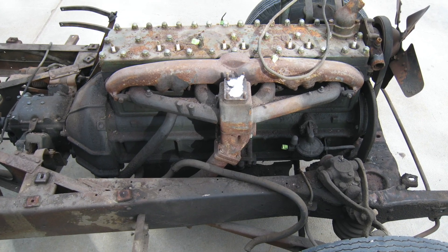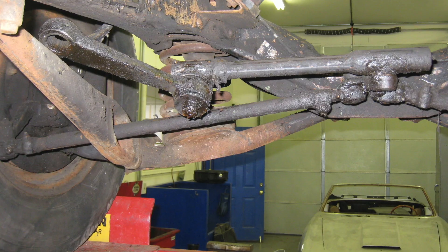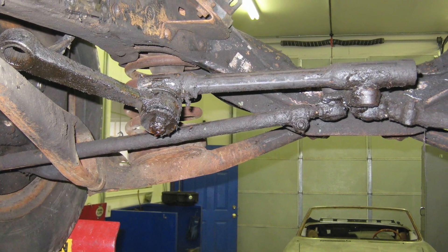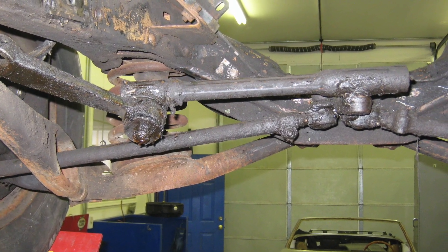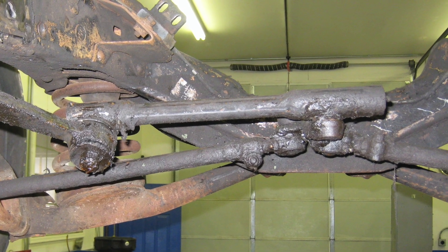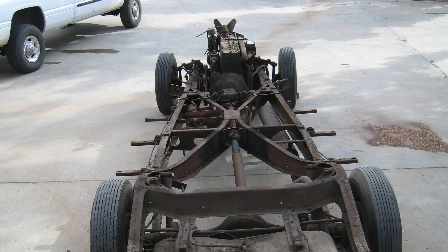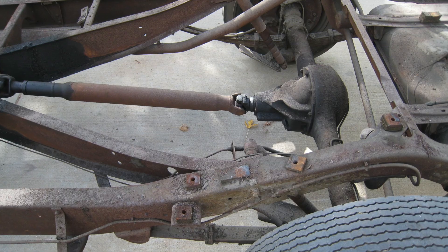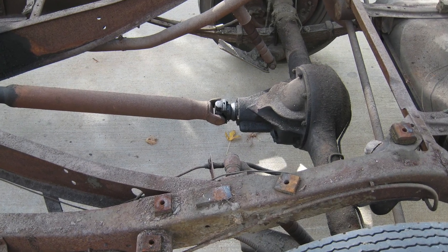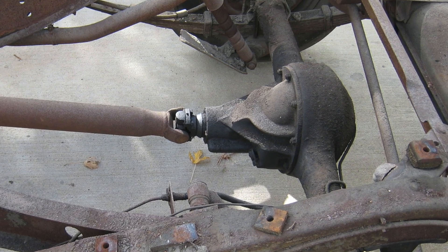Manifolding was pretty standard with a downdraft Carter carburetor on this particular model, which worked extremely well. The steering was a center-pivot design, again a carryover from 1935, adopted by the senior cars starting in 1937. Gas tank mounted in the back, of course, and an open drive shaft with the Packard hypoid gear setup so they could get the whole thing lower — the drive shaft is down toward the bottom, not in the middle of the pumpkin in the back.